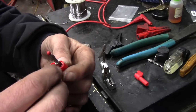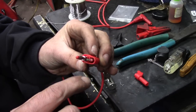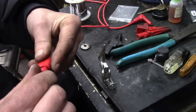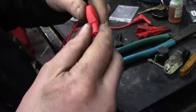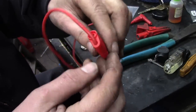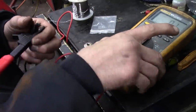Same thing here - we're going to push this through nicely, try to keep the wire centered inside. Now push this in, line her up and push. And if you look, you have a nice positive connection. Grab a new terminal. That's better.